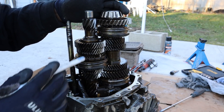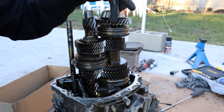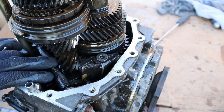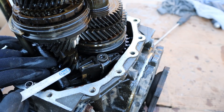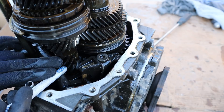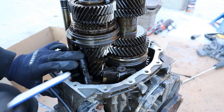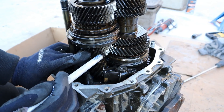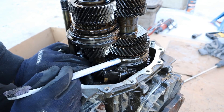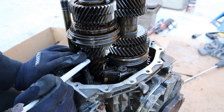This is a five-speed manual transmission. All of the gears have an angle cut — helical gears — to reduce noise. Usually reverse gear in many manual transmissions is just a straight cut, which is why you hear that whirring noise in reverse, but in this case they've also put in a helical gear for reverse. If you have a small gear turning a large gear you get a low gear ratio and high torque, which is what you want in first and second gear. First gear is this helical gear on the input shaft driving a much larger gear on the counter shaft. Second gear takes power from here and transmits it to this gear, and when the fork is selected into second it transmits power down to the final drive — this gear is slightly larger and the mating gear a bit smaller than first gear, giving a higher ratio for more speed.